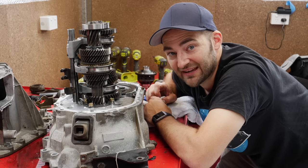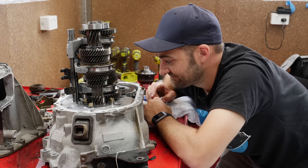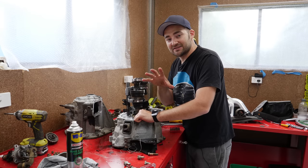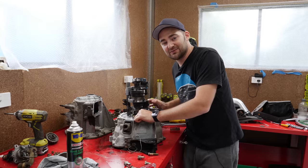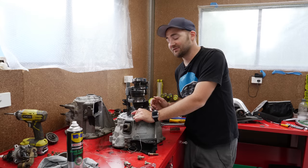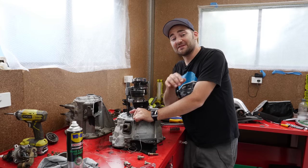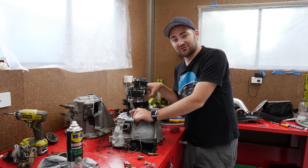I've also got a bit of a deadline because our battle date is looming and I need to have my car back together. I did find the original workshop manual for a Lancer but the gearbox it covers is not actually the same as this, and you don't realize until you go to take the diff out and it's completely different. I forgot one of the most basic things - look for the actual code. Engines have them, like 4G69. Gearboxes have them too. In this case it's an F5M42, which is really common - it's in gearboxes from Mitsubishi all over the world, all sorts of front-wheel drive cars. With that information it opens up all these extra resources of videos, photos, forum posts and stuff where you can get the sort of info that you need when trying to do an upgrade such as this.